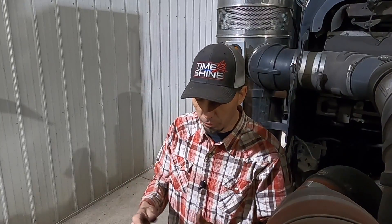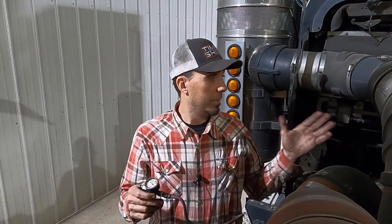If you hear any background noises in this video, it's extremely windy outside today, so the shop and the big bay doors are making some weird noises. This tool here is something that was made by my buddy Mark — he loaned it to me, and we're going to use it to pressurize our fuel system. That'll help us diagnose where we have fuel leaking into our engine oil.